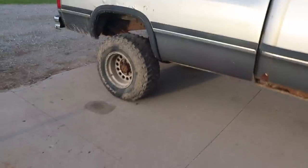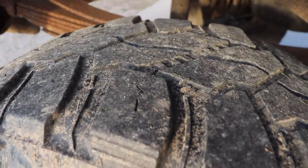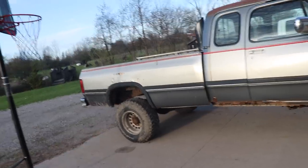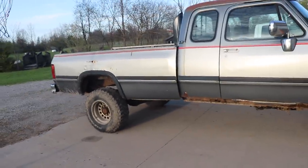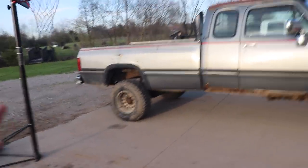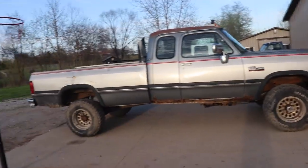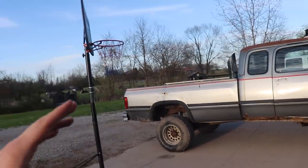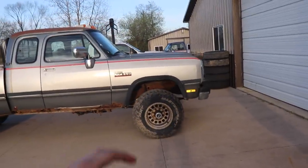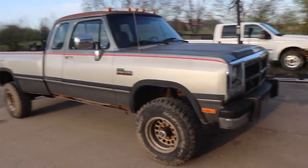The truck does fine because it's four-wheel drive, but if you look at the tread on these tires there's not much left. I was kind of surprised we were able to get the traction that we did even when we laid into it - it grabbed and went pretty good. But I just wanted brand new mud terrains so we could go through a little bit deeper mud. It's running 31s right now, 31 by 10.5 wide, but we're going to the 35 by 12.5 wides.